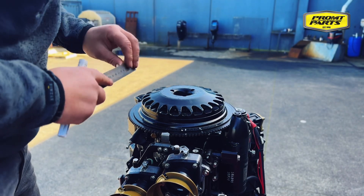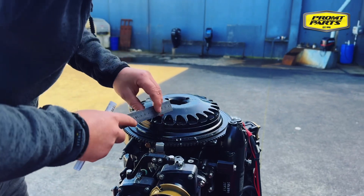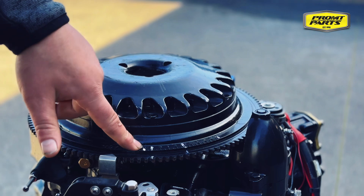On our flywheel we're going to mark four centimeters past TDC — after top dead center — and put a white dot. Now this has stopped on 20, so we'll match it on 20 on the other side.